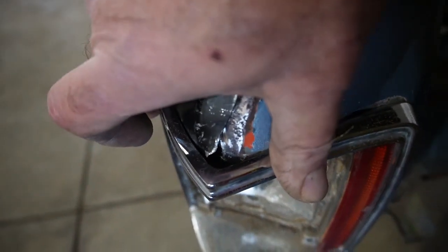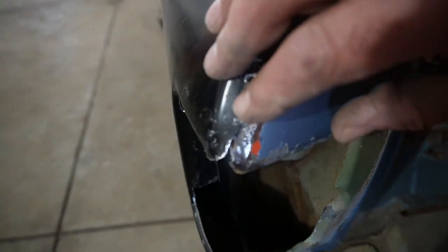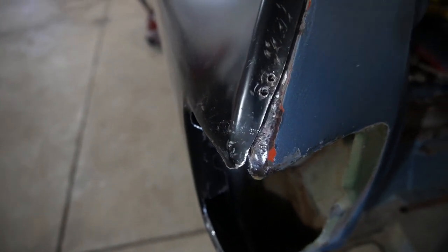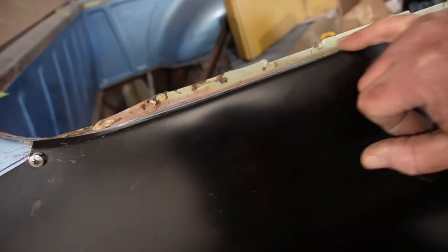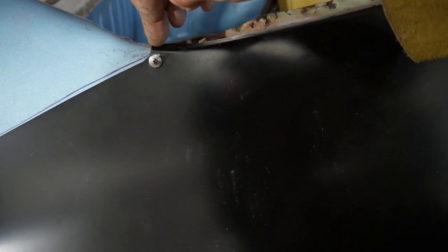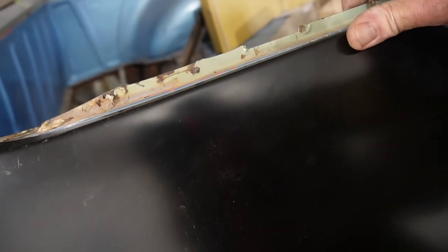Remember, this corner has like a molding and so on that is supposed to go there. We're gonna fill that in with something different, but I think we're in pretty good shape. I'll finesse that a little bit, but then what I wanna do from there is make some marks on where we need to cut that top portion. This has got to go, make that line here, and then try and get the alignment all along the top and drop that in. I think I'll slice that and bend this flange down a little bit so I can slide that on there, and then make sure it's getting all the way up in there.